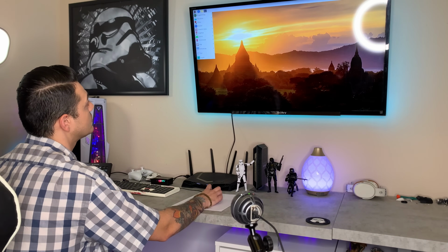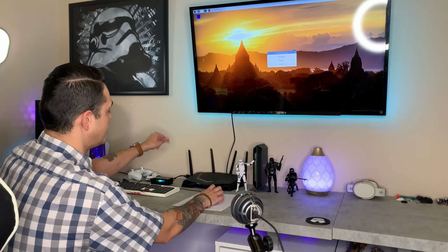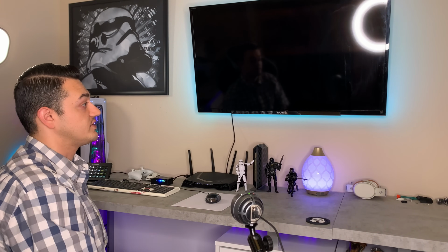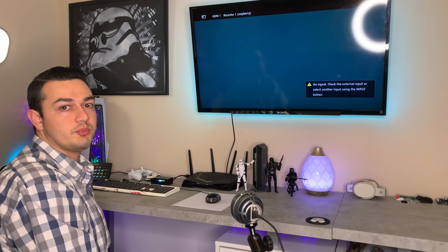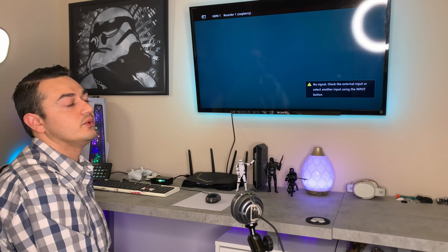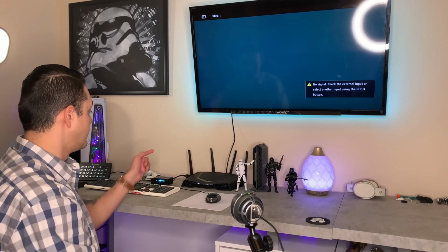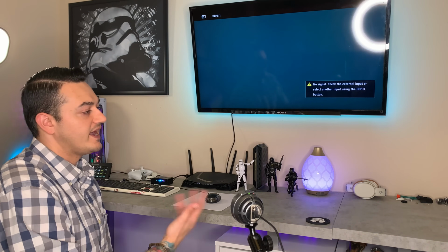I don't recommend, when you're using Raspberry Pi OS or Raspbian, shutting down just by turning off the power switch. I recommend shutting it down like a regular PC, so that you don't corrupt the SD card with the operating system on it. However, inside of RetroPie, you can shut down manually, but for the longest time I was shutting down just by turning off the power switch inside of RetroPie, and had no issues.